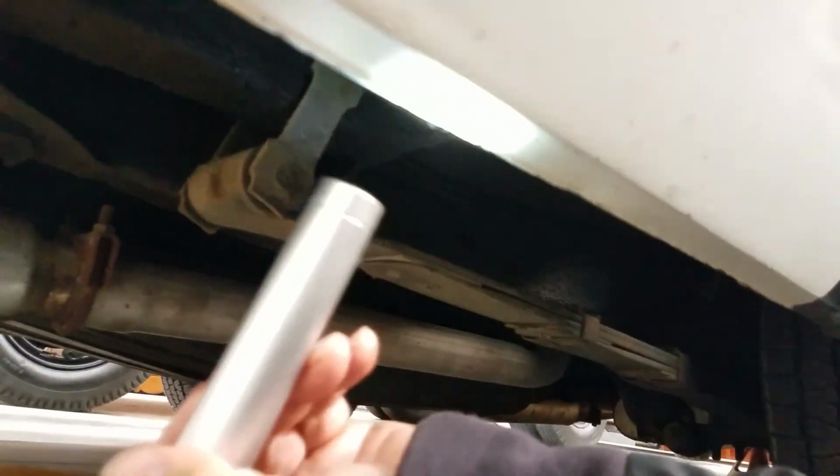You can see the original corrugation in the metal. Nothing's been cut or sectioned out of there. That's good. And the back sides of the splashes are flat. Usually on the back of these splashes you see this reinforcement finger, 3 of them on the panel. So I don't know if that's been changed or altered. I'm going to say it has. I'm going to say these might have been repaired when some quarter panel repair work was done, because the tabs that you normally see that lock the inner and outer quarter together, those have been replaced. Those are missing.